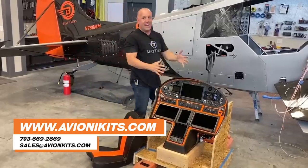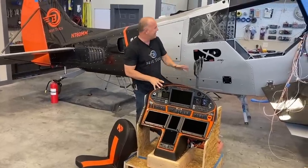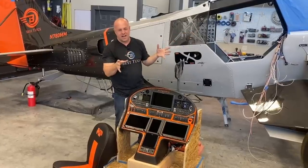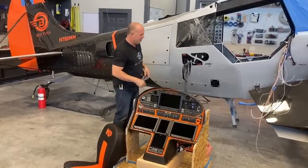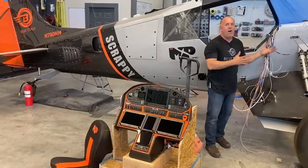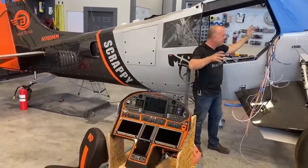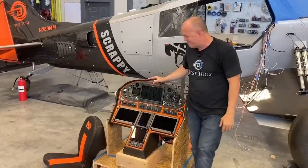The plan now is really exciting — this was designed to go through the door, so I made sure the door and the panel would work and I could lift it up as one assembly and drop it in in five minutes. It won't take five minutes to then tie in and plug all the connectors — we'll spend hours doing that — but the whole system can come in and out of the airplane. I'm going to finish terminating all the ends. All the terminations throughout the whole aircraft are done — autopilots, plugs out to the wings, same on the other side. Pitot-statics and static ports are in.